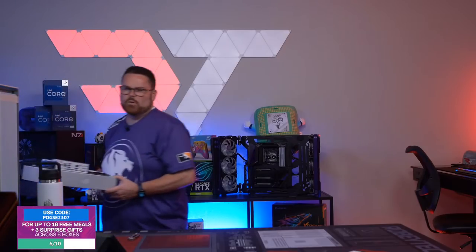So somebody was asking, hey, Robeytech, why did you do the washer mod on the build? The reason we did the washer mod is that sometimes, especially on this newer socket, there's two things. One, there's sometimes pressure, right? So this relieves the amount of pressure that's actually put on the CPU, so the CPU has less chance of bending. The other thing is that it also raises up the overall socket, so you get better contact with your cold plate. Because you're not getting the bending, you're getting a flat surface, and that has worked better with coolers.